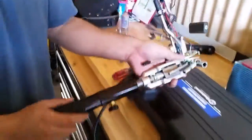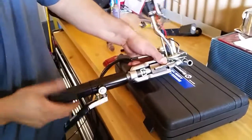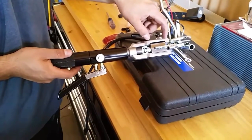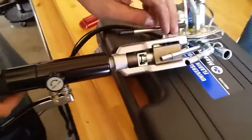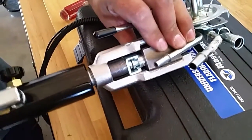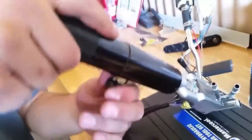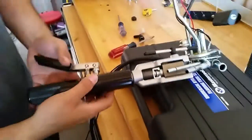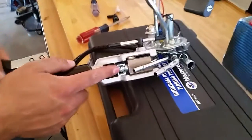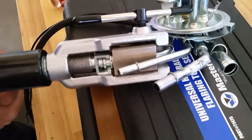We're just on the very edge. We just had enough pipe to get this one done. So pipe's in there now, and the die's already clamped down. Now I'm just again twisting this guy until it stops at the very bottom. Then down here I'm shutting the valve and then operating the hydraulic ram. And you can see right here it's going to push the pipe internally there. And that's it, just set.